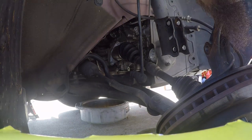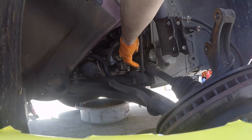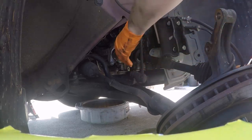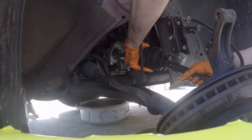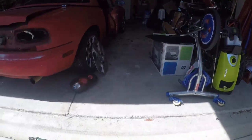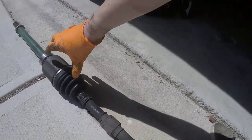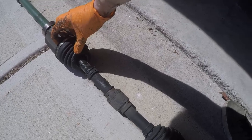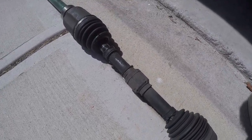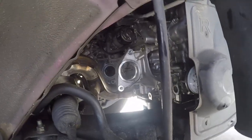Here goes nothing — and that was easy. So this is what it looks like with it out. You can see this boot right there was torn, so grease is getting out. This one on the other hand — grease is getting out AND other crap is getting in. That causes them to bind up and basically destroys the CV joint, causing vibrations first and getting worse from there. We've got brand new ones going in. And we didn't spill any transmission fluid — that makes me happy.